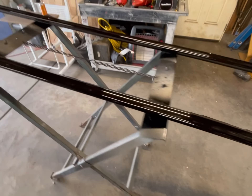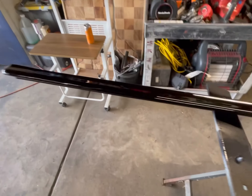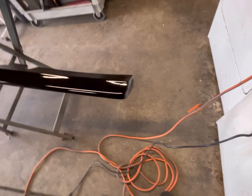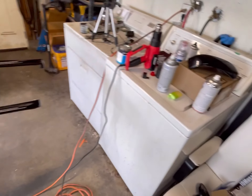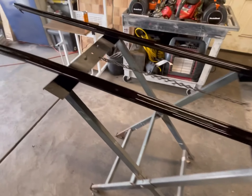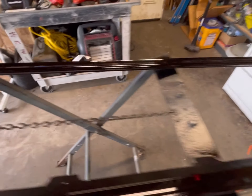The heat gun worked — we got it to dry enough. Here's the first coat of clear right there — doesn't look too bad. It would have come out a lot better with more prep, but I didn't really care too much about the side skirt extensions since my car is really low and they're probably going to get blown out in a week or two anyway. What I did pay attention to was the mirror cap and the wing because those are color matched and actually visible.